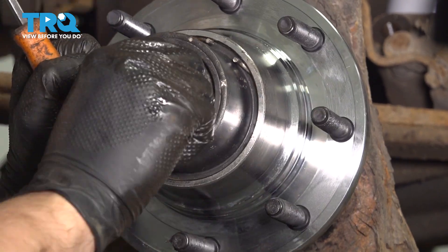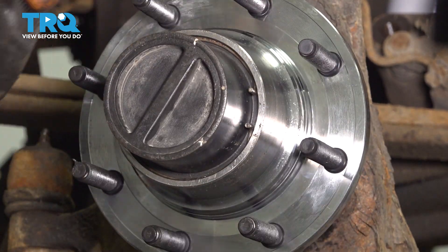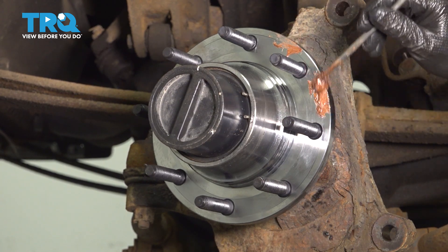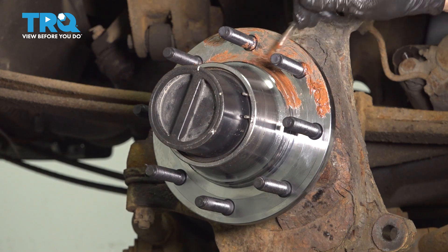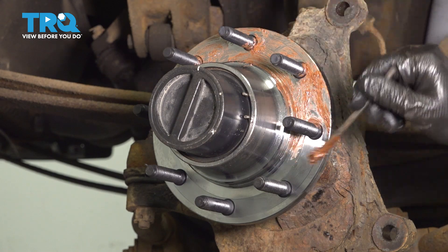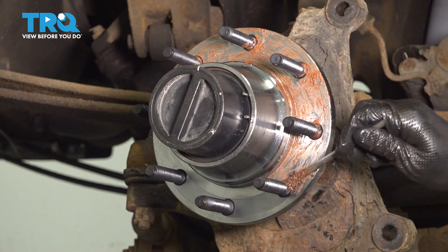Now if you wanted to test the functionality, make sure it actually works. On the back of the hub we're going to put anti-seize so that it doesn't rust in the future, especially on the outer ridge and the inner ridge. This will also prevent the rotor from seizing up on here and prevent rust — which is important, because if it does rust, it'll swell up and push the rotor out, and you'll have issues with your brakes such as brake pulsations and uneven brake wear.